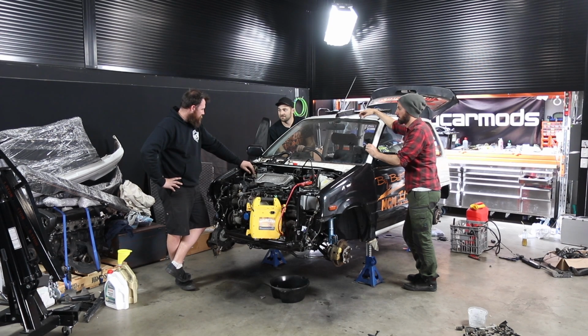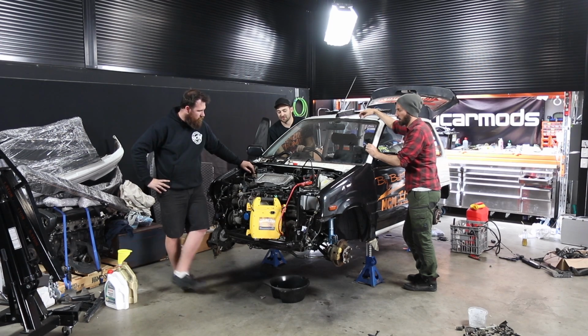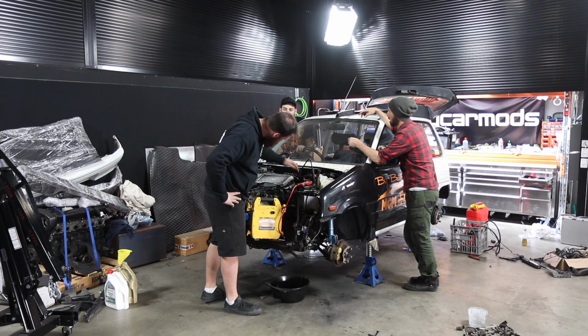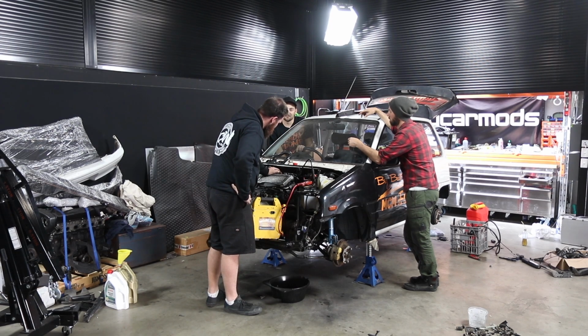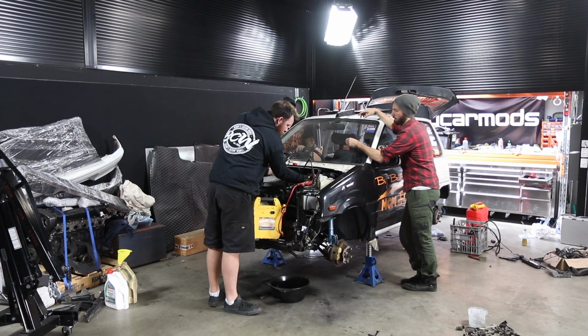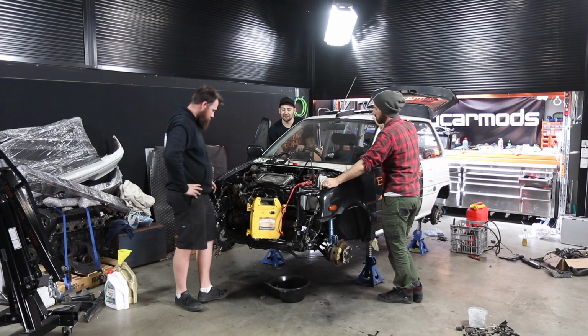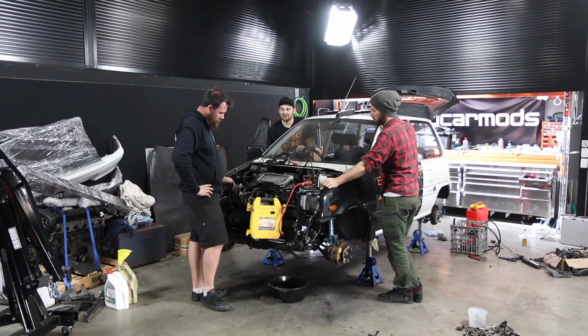There's no funky immobilizer or anything in it? Don't think there was any. I don't think there's any immobilizer stuff. There's only that weird turbo timer relay. Oh yeah, that was the only thing that was in it. I've plugged everything back in, but there could have been something hacked under there that I haven't seen. It had extra wiring that ran down the front, remember? Coils definitely plugged in. Yeah, there was a weird relay on it.